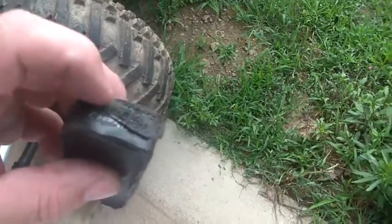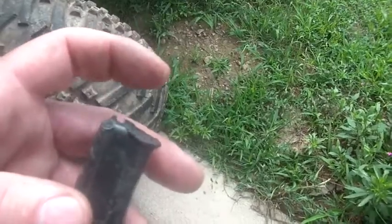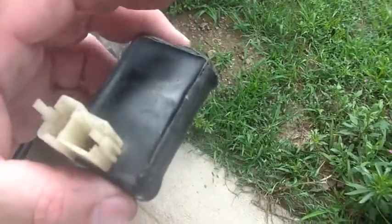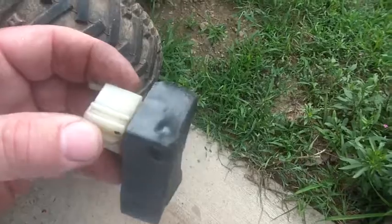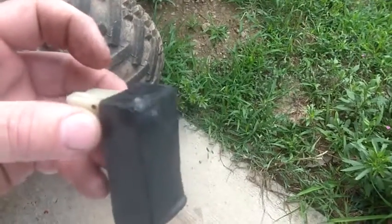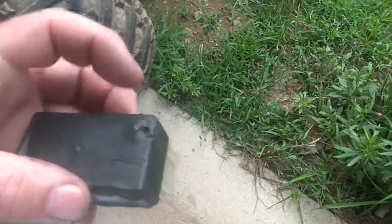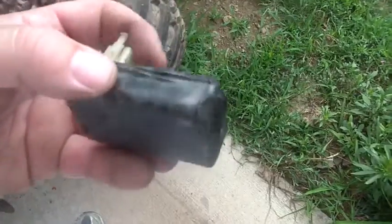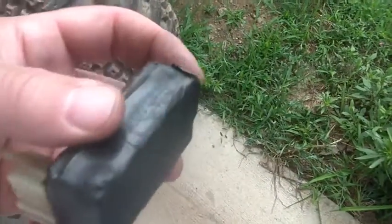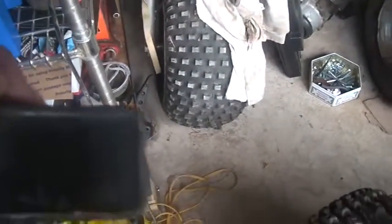The way it's burned here, I'm thinking it was up against an exhaust pipe. Also, if you look at the roundness of the burn, it kind of looks like an exhaust pipe. Though generally speaking, it looks like the whole thing was hot as heck. I could see pretty good through the screen. You could see it actually melted here and started to conform to some of the internal components. And right here, it actually started to melt and bubble. This thing got cooked good. I think she was literally up against the exhaust. That's what got it cooked. Though I didn't notice any burnt plastic on the exhaust. Normally you would expect to see that. So anyway, that's one thing.